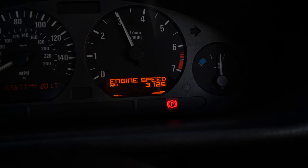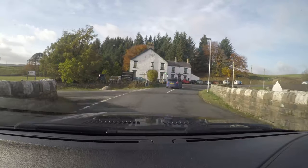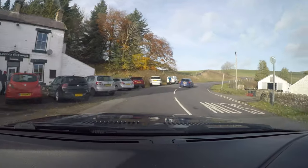It can also do some pretty impressive stuff with Wi-Fi and Bluetooth on your phone. One of the most valuable things about Gauge S is that it's not just a visual display unit - it can actually log the data on the car. For anyone tuning an E36 with a Siemens DME, or the other compatible ECUs listed in the description, it's able to log the information coming out of the ECU and then automatically download it to Dropbox, where you can click through the data. That kind of blows my mind - all my previous tuning stuff has been done on a laptop which is cumbersome. To have it all in the gauge is incredibly cool.